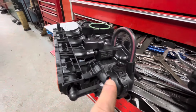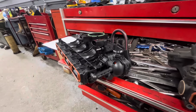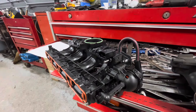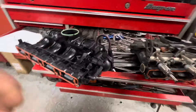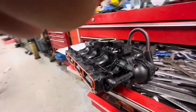The solenoid has a line here and a line here. This is your signal to the actual intake manifold vacuum pressure. And this is the control to the vacuum solenoid. On the other side of it right here, there's a little vent. It's an internal vent and they don't completely leave it open — they restrict it down, but they just feed it to atmosphere.